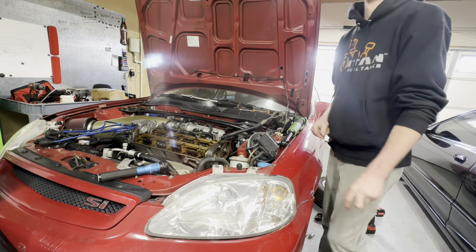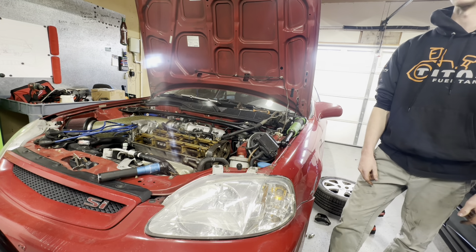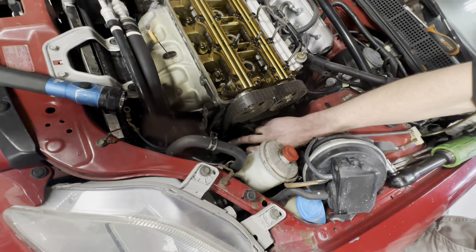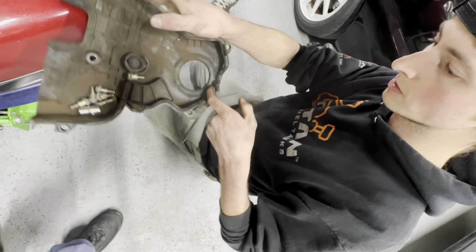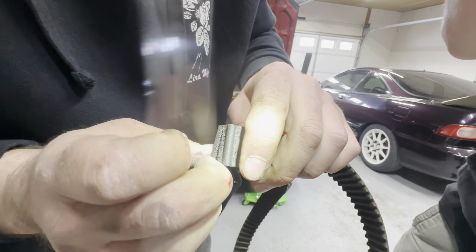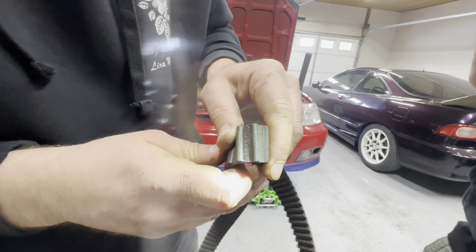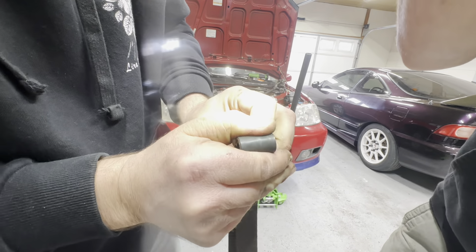It's definitely been in there rubbing for some time - all those V-TEC pops. Holy shnikes, that's so scary. We were going like maxing out 50. The spec on this is supposed to be like an eighth inch - it's all timing belt material. Pretty soon that would have ripped off the teeth on the belt. It's on its way out. There's scoring from the top - doesn't look too bad from there though.